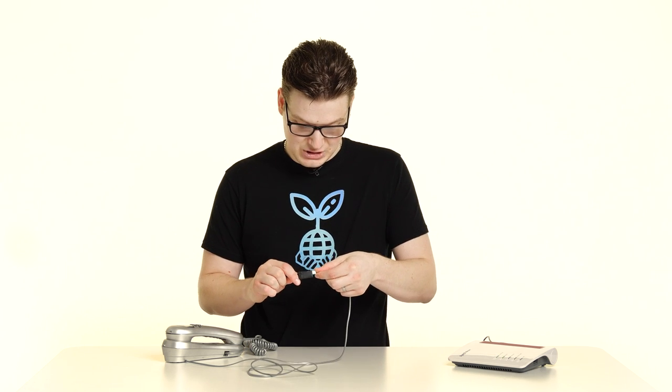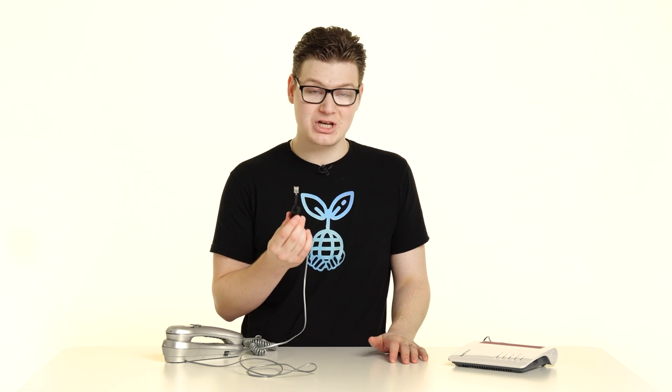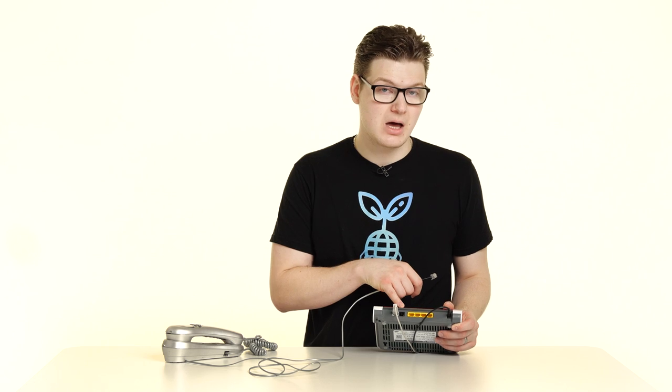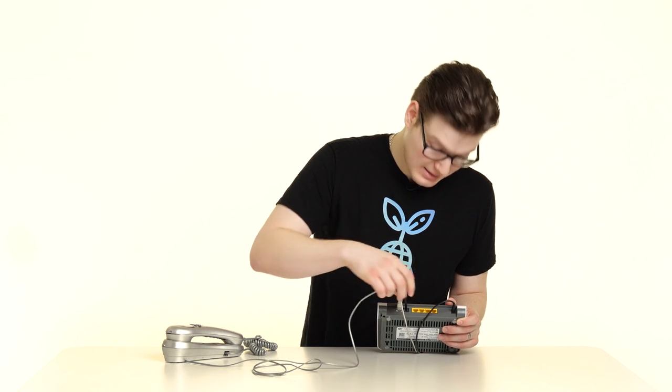Now what we want to do is take the flat phone connector and the black adapter and simply connect it. What we can see is we have a small RJ11 or DSL style adapter on the end of the plug. Now what we need to do is turn it around, and on the back of the Fritz box you'll find the black F-O-N or phone port, and we connect the adapter in here.